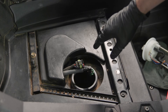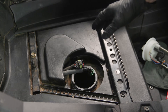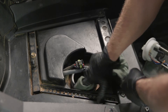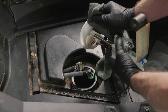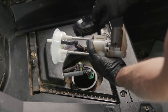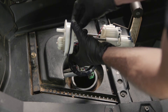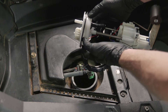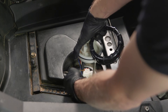Before you put the fuel pump in, look down into the tank and check for any sand or mud in the bottom. If there's anything down in there, take the tank out and flush it. Ours looks pretty good, so I'm just going to clean the sealing surface both on the tank and on the pump. Polaris recommends replacing the plastic nut and the gasket any time the fuel pump is out — we have an All Balls option available on our website. Go ahead and install the gasket onto the fuel pump, then set it down into place and rock it in just like we took it out.